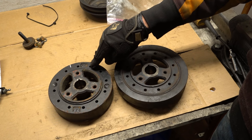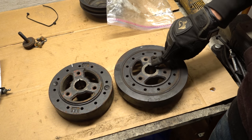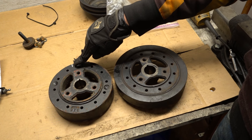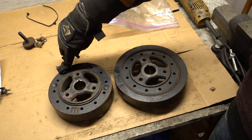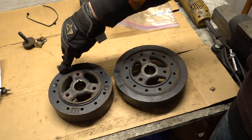The reason this needed to come off is because the pointer is not in the typical location. If you look at where the dowel is — they're both facing up right now — the timing notch is right here on a typical pulley, and I have a sharpie line right there so I got pretty close on that one. But the notch for zero on this balancer is all the way over here. This is a 12 o'clock balancer, meaning that you would check the timing pointer straight down — the notch is there.